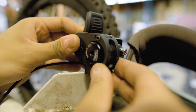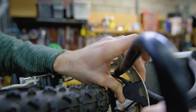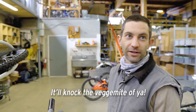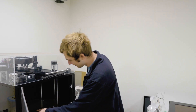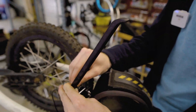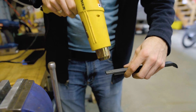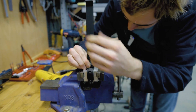This will be pre-tensioned so we take out zero. When the brake is pressed we're going to start getting more and more regen right there. The SX motor packs so much power. We've got the part we just 3D printed and CAD'd — it's going to go on to the throttle. Here we'll get the visual test fit. This is so you can get a good sense of how hard you're pressing — push your leg and it goes forward. We're going to heat this up so it can bend and conform to the throttle, and that way we'll have even pressure across it once we screw it down. It's not going to melt — it's just going to be formed.